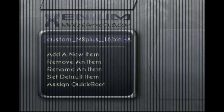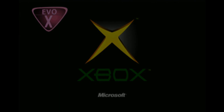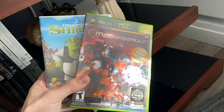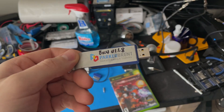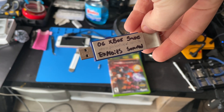So let's first tackle the easiest way to solve it: the soft mod. The absolute safest way to modify your Xbox is the save game soft mod. This is where we introduce an exploit into the Xbox by way of loading save games injected with a special payload that will bypass the security of the Xbox and allow us to install soft mod files. There are quite a few games that can allow you to do this, the most popular of which is probably the original copy of Mech Assault. Platinum Hits versions of games can be a little spotty on whether or not they'll actually work with the save game exploit, so I recommend getting the non-Platinum Hits version. Simply confirm online which versions of games are compatible with the save game exploit.